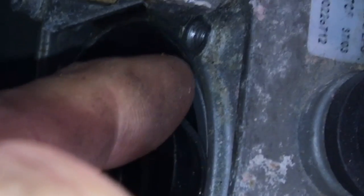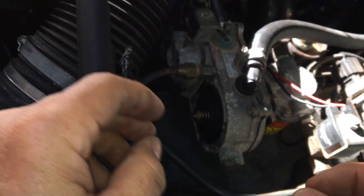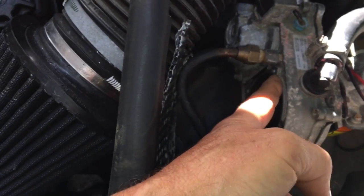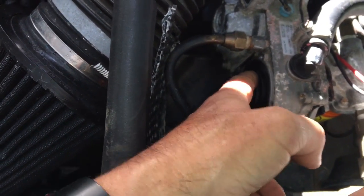As the springs push in, the rubber tends to bend up at the edges. Especially if the lid is on a little bit skewed, the rubber can bend over and you don't get a very good seal. A little trick I've used in the past is to put a tiny little smear of superglue around the metal edge - just enough to stick the rubber down around the edges to stop it curling up when you're pushing it back on.